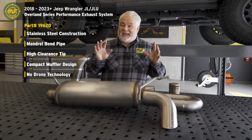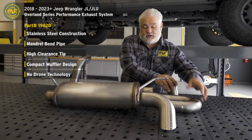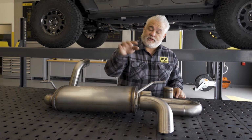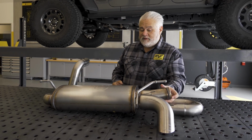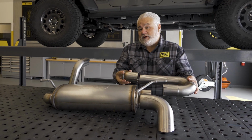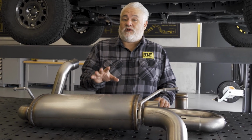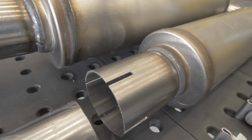The second part of that means we have the three-stage tuning system of NDT. NDT incorporates three different components we put in here: our cap, the U-bend, and of course our Helmholtz chamber. Now, this muffler is a straight-through muffler, which means there's nothing inside to impede performance, but there is a port that allows us to cap it off and create a quarter-wave resonator that's about 14 inches long. Now, we can incorporate the extension and put that cap on here, and we'll have one that's about 24 inches long. The difference being is the longer the tube gets, the lower the frequency is that you tune out. Effectively, the way that our NDT technology works, you're going to be able to tune out the frequency you don't want by creating it inside the tubes that we provide.